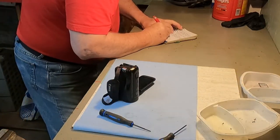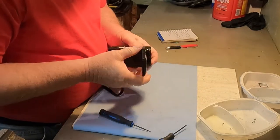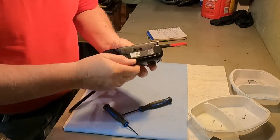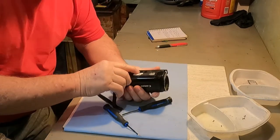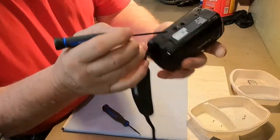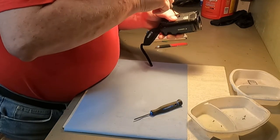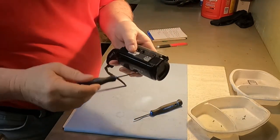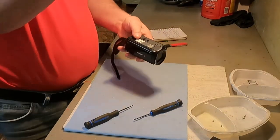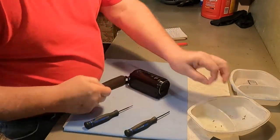And then the front. Now what happens? It seems like this side of the camera should just fold right out of there, but it seems to be held — there's a little indentation right there. I'm thinking there's a screw head under there. Yes, my God, there was a screw in there. I had to put my magnifying glass on it to see it. And it's a medium screw — right hand cover.